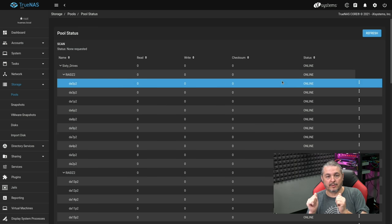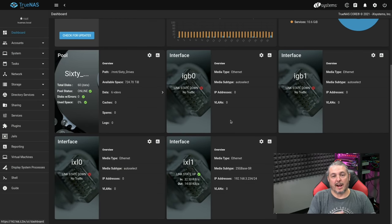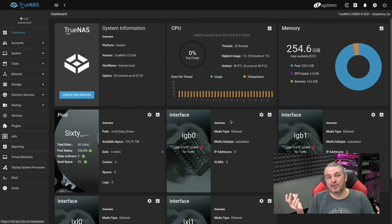There's not a single answer to this question — there's the optimal answer for the way you want to use your storage pools and the efficiencies you're looking for. A few people asked why there weren't more hot spares set up, and because the admins using this are very technical, we're not too worried about hot spares. They'll just have extra drives and swap them out as needed. They really want to optimize for the most reliable large-scale storage possible, with lots of data sets connected over SMB shares.